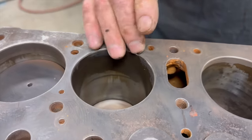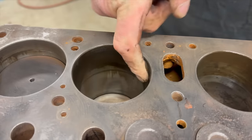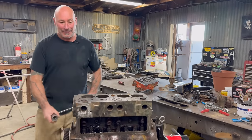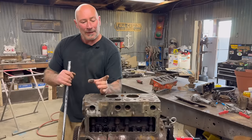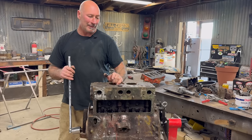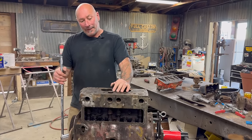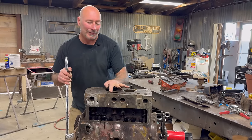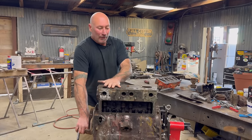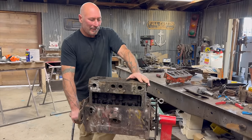The intake valve was open and it must have rained on the carburetor and went in. See how perfectly polished and smooth this is? This one's got a little action — it's not smooth, I can feel it. And the pistons come all the way up, seemingly almost completely to the top. So there's rings in there surrounding the piston — that are like — that's the seal you're feeling. So if these aren't making perfect contact, then the compression in this cylinder will probably be low. It may blow oil out, it may backfire. And then these valves all need to seat perfectly too to be perfect seals.